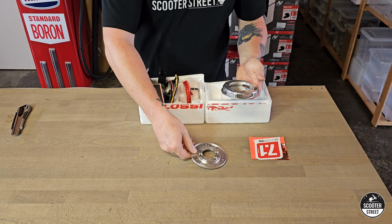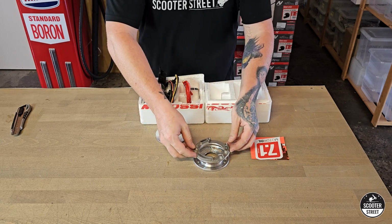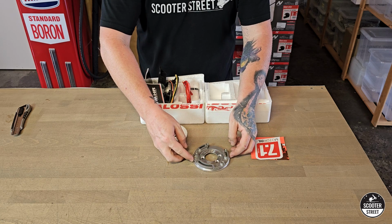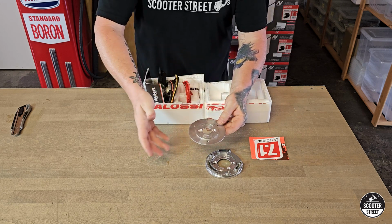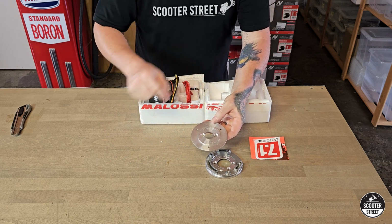Okay, so it'll be our mounting plate that bolts to the bike, and this will be the timing adjustment plate. Those are elongated holes where we get our timing adjustment from, and that will be the flywheel. So obviously on the air-cooled one, you still need to run an air cooling fan. So we've got our mounting points for the fan.